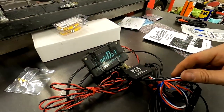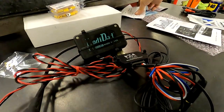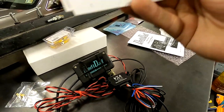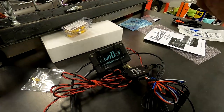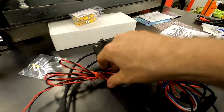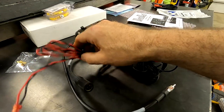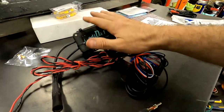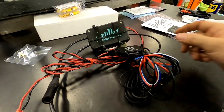And I'm actually going to splice into the RediRad power lead, because I'll double check everything out here, but the power draw for our Bluetooth adapter is extremely low. And it shouldn't be an issue to add a little bit more, like, milliamps onto this line. So between the two power usages, shouldn't be a problem to do that. That's what we're going to do.